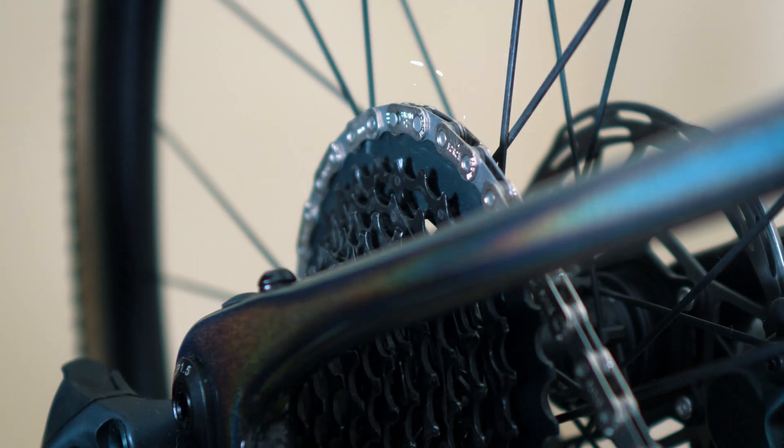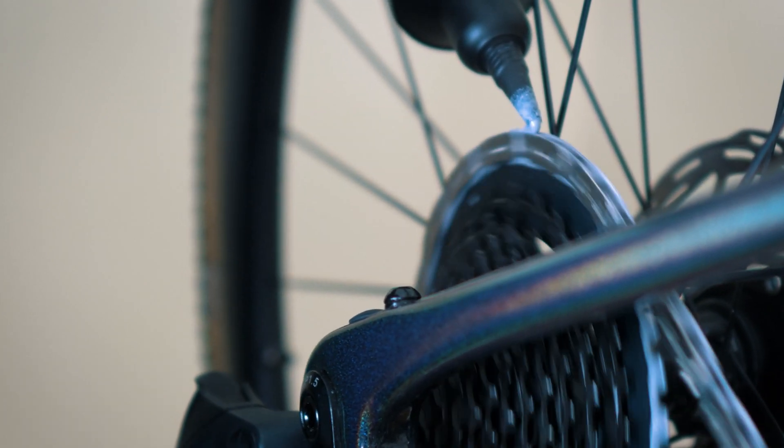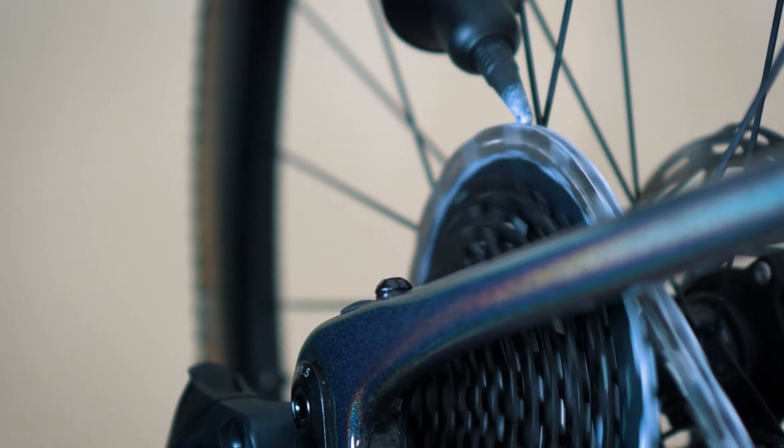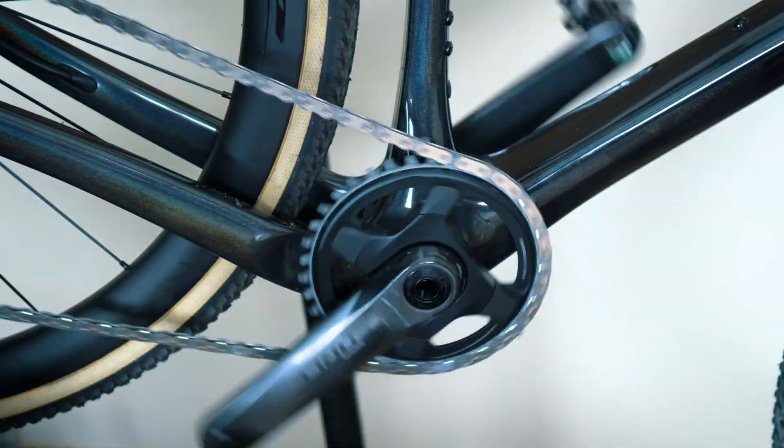With the clean chain back on your bike, you're ready to apply the UFO Drip. Before applying, make sure you shake the bottle so all the wax components are blended evenly. You'll notice an agitator inside the bottle to help everything mix together. Apply it just above the cassette to catch any excess dripping through the chain. Look for a quick link or master pin and start there, doing two full coatings of the chain while turning the cranks backwards. If you don't have a quick link, roughly 8 to 10 seconds of pouring should do the trick. Once applied, carry on turning the cranks backwards for another 20 to 30 seconds to help the formula get into all the rollers and links properly.